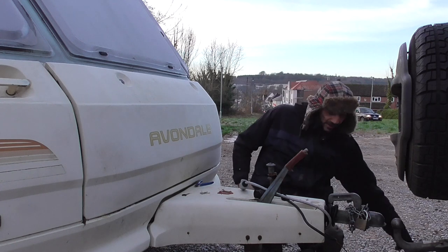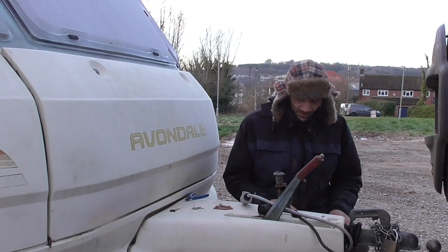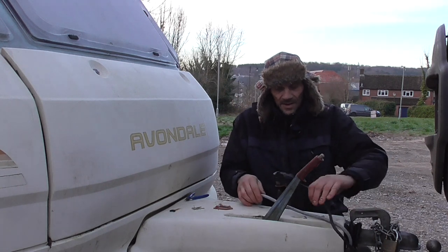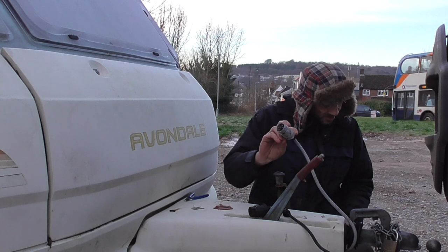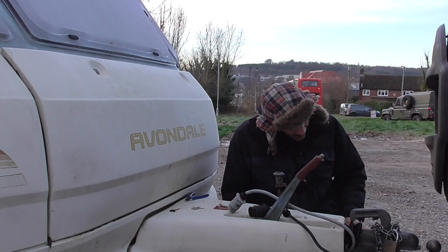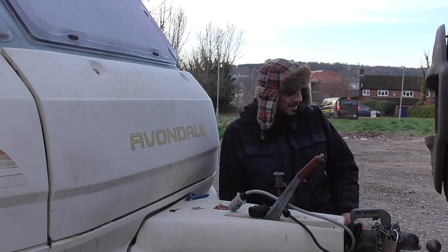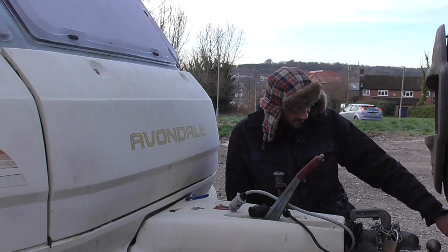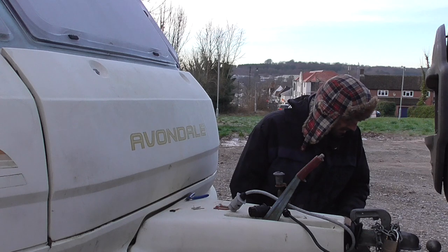I've also got an aluminium trailer plug for it. I'm going to have to rewire the trailer plug because it's so rusted out in there — there's just no point trying to swap wires over. I need to find a solution for a socket on my car because they didn't supply a bracket for a second socket. So I'm going to have to get the double adapter plate and use the bolts on the one that holds this one to the car to hold the adapter plate on.